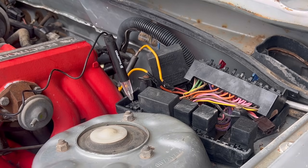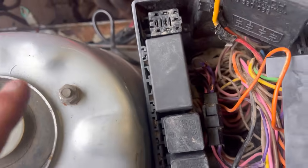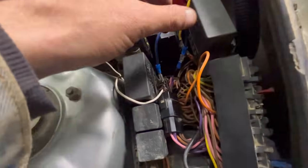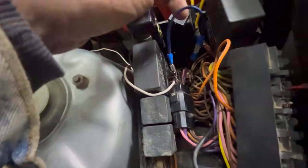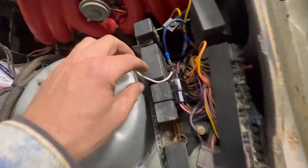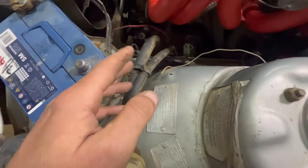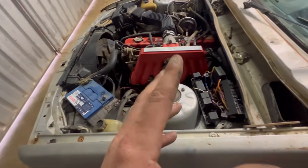and we've got power. My next problem is this is obviously the fuel pump wiring, so he goes to there, but battery's connected, key is on. He doesn't do anything. So I've jerry-rigged this up. This feeds the connection from there to there for the fuel pump. But even with that connected, I still wasn't getting power to that. So I've had to wire this in straight from the battery. And that provides the fuel pump with power. And now it will do this.